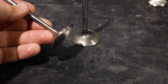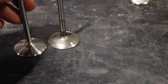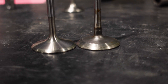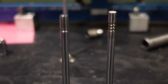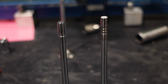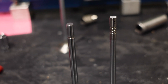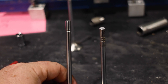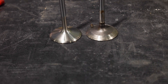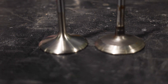And now, here is the HeadGames valve. This is a valve that we've been getting made for years. It's not commercially available, but you can get them installed here. You can see that we did an undercut — see how the valve stem is undercut compared to the OEM. And if you go up here, you get a single groove. Single groove versus triple groove. We thought the single groove would be cheaper to make because it's only one groove. What we learned was it wasn't really that much different to make, and the cost was not there. This is a $70 or so per valve, and that's the triple groove or the single groove. But the real detail is in that tooling. The design change was pretty, pretty drastic.